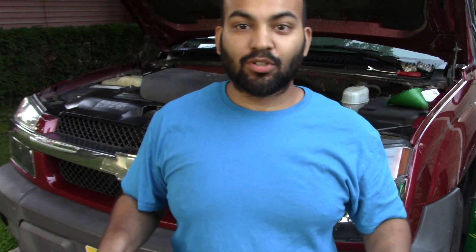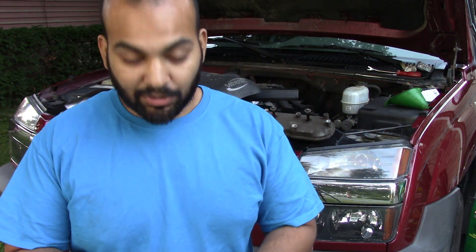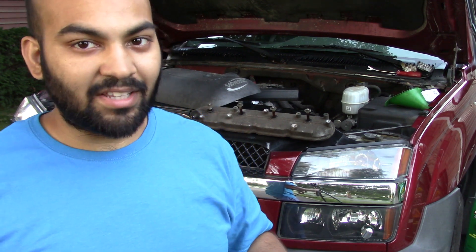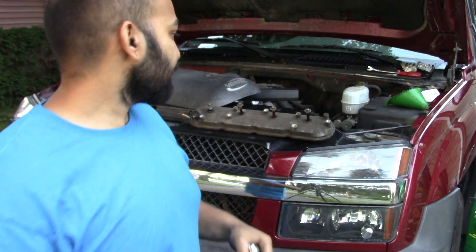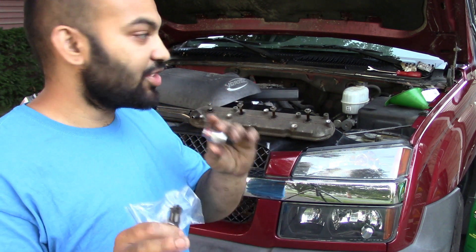Thank you for watching this episode on how to change the valve cover with the PCV valve for the 5.3 Vortec engine on my Chevy Avalanche. Here's the old one, and we put the new one in already. The engine is running so much better. I also did an oil change — I didn't show that on camera. The next episode I want to change a little filter that goes inside the oil pressure switch to help the truck run better. To get the sludge out, I'll be doing oil changes much more often and I'm putting synthetic oil in the truck.